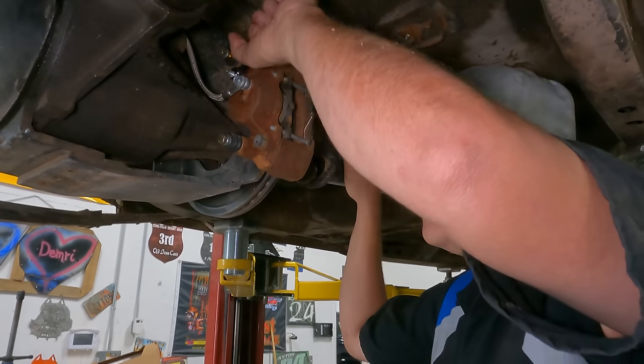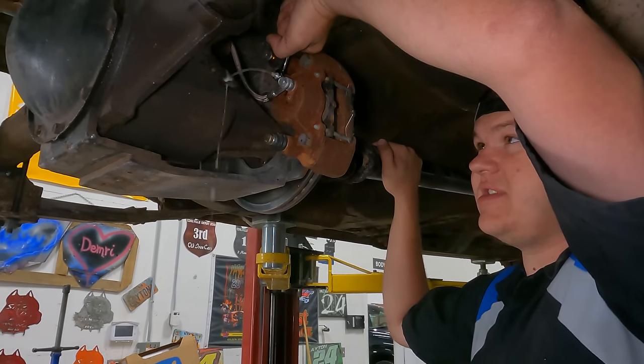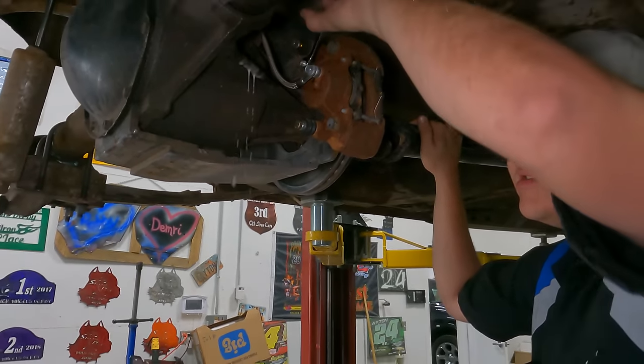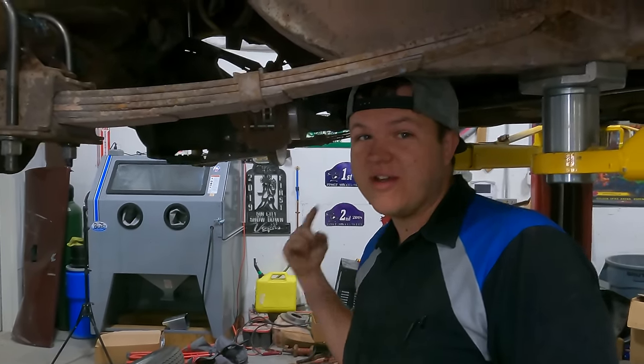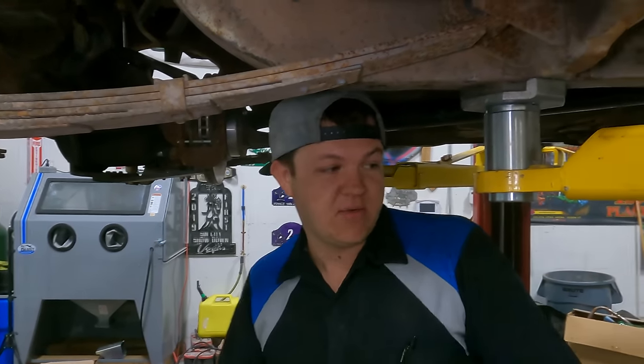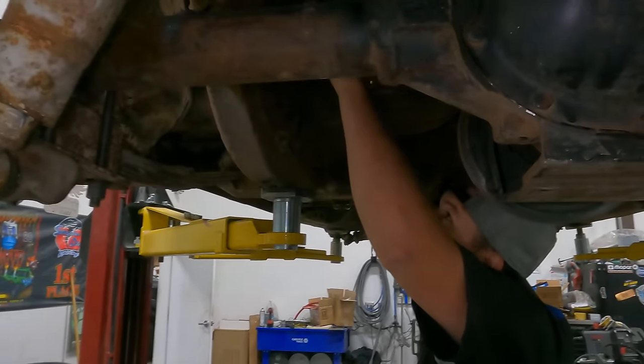That time. You know, you can pump it like 5 times and it'll do just the same exact thing as 50 pumps. I don't know where we're getting all this air. So we just figured out why we're getting so much air. The coupler inside the car is leaking. So we're gonna tighten that up and re-bleed it.